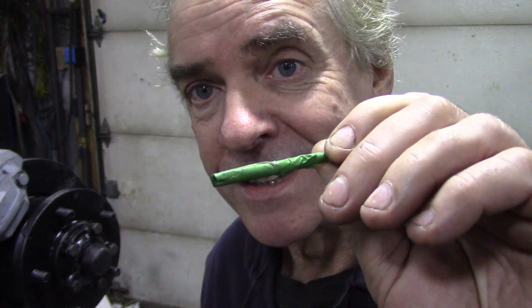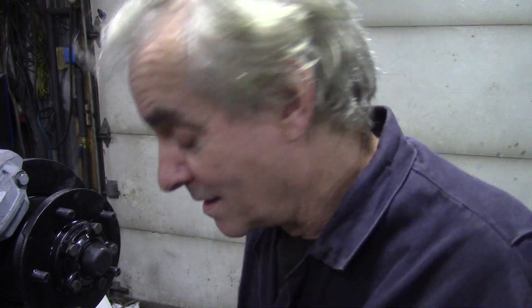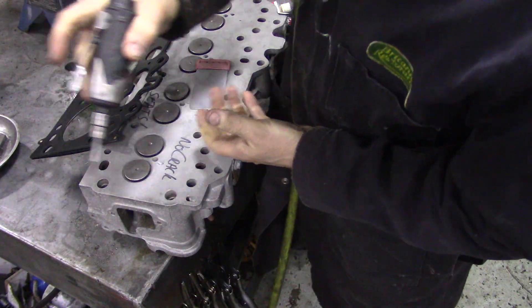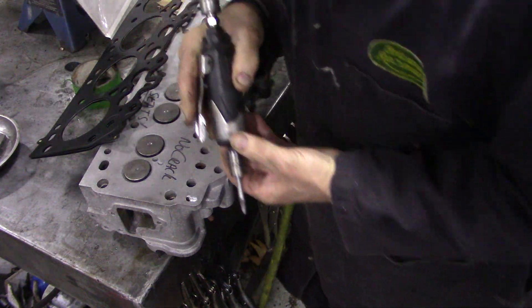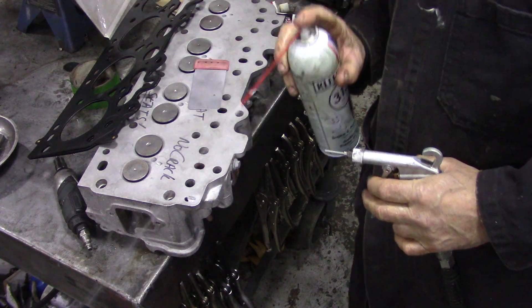And the reason why I'm using the cotton wool bud is that if we want to drill it out, we can cut it — it's usually a little hollow tube — and progressively drill it out till it's disappeared. So all we're going to do is rough up that area with a die grinder so the JB Weld has really got some bite in there. Then get some brake cleaner in there to clean it up.